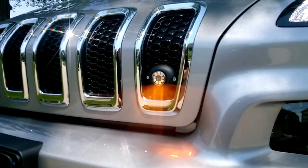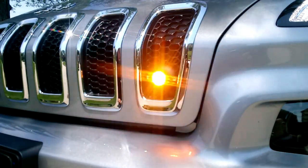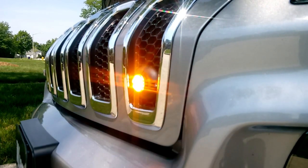They are concerned about damage, so we've surface mounted the HAW DUO with our mounting flange in black right on the grille. I'll show you what I'm talking about a little closer. Right here, you can see how we've used the mounting flange in black and a LED HAW DUO. This allowed us to surface mount a set of hideaways right here on the front of the grille, so they can be removed without any damage to the grille. When the vehicle's turned in, we don't have any holes to explain or any payments to make for damages caused by lighting.